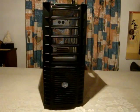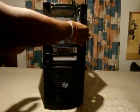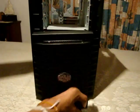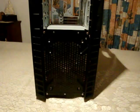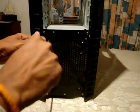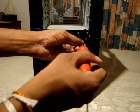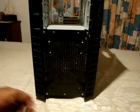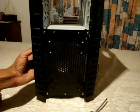Next I am going to undo the front of the casing. You just flip out these five and a quarter inch bay drives — it is an easy task. To remove the 230mm fan you have to pull the bay and it just comes off. There are four screws you have to undo to get rid of this 230mm fan. If you prefer, you can install a 120mm fan, but I suggest you keep this one. Afterward you can just take this out.